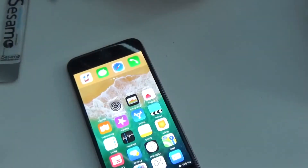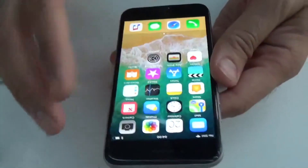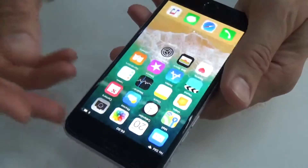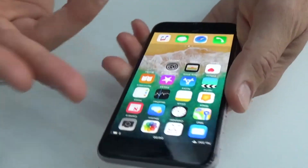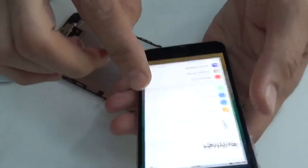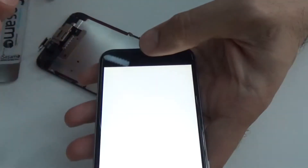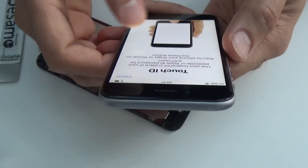Remember, if you want to change the screen, try to find a faulty phone and replace it from that one. That way you get exactly the same screen and you know you're getting a genuine piece. If you find a phone that's scratched on the back with an activation lock on it, you can pick them up really cheap and just use the screen. That's much better than buying a dodgy screen from somewhere else. The touchpad is also now working on this as well, so if I go into Touch ID and try to add a fingerprint — unable to complete Touch ID setup, please go back and try again. So there is a problem with that.